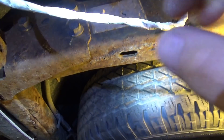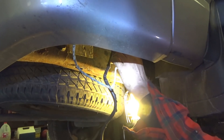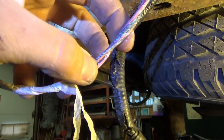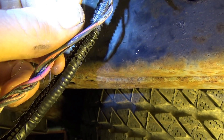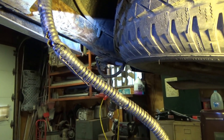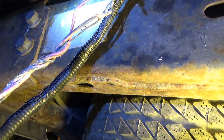Before we put it together I want a picture of it. Look how green it is in there. With the light out and the wire separated, we should be able to fire it up — but we want to fix it properly first. We're going to cut this wire, strip it back, hopefully there's some good copper left, and fix it the right way with solder and shrink wrap. The rest of this harness — the tape is trapping moisture. You can see salt and corrosion all the way through, just white crystals of salt and calcium.